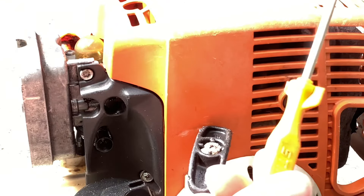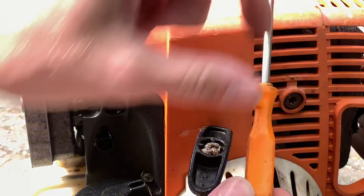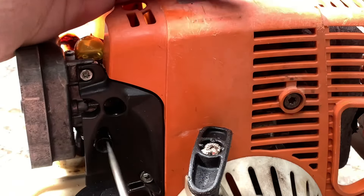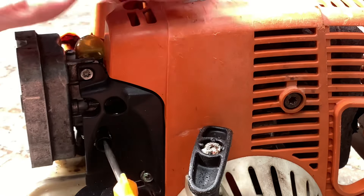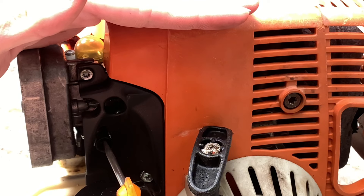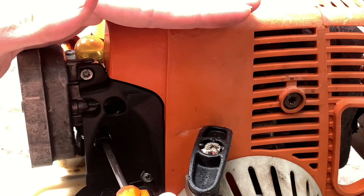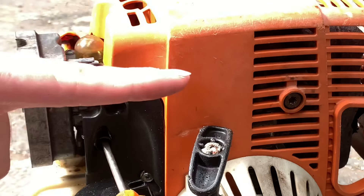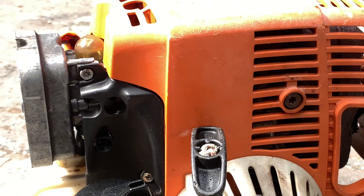Get your Stihl tool. You don't need to, but this just gives you markers to tell you if you're at a half turn, quarter turn, or full turn. Start with it straight up, then turn — say — a quarter turn. I'll go a quarter turn towards the whipper snipper, towards the pull starter. We'll see how that is now.